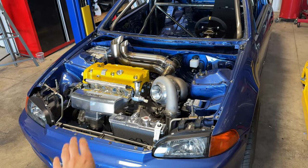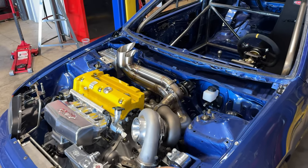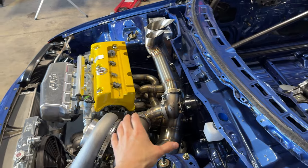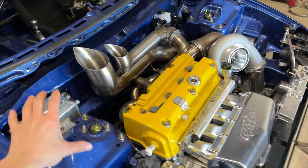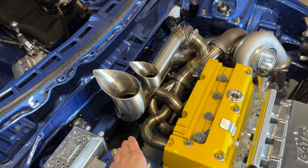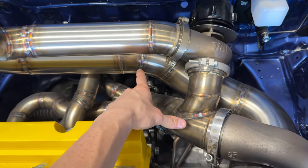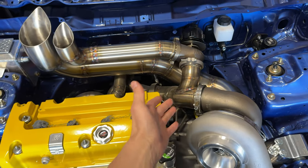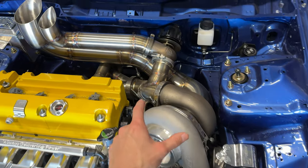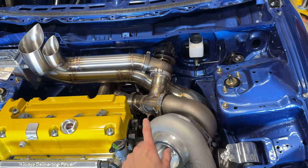The whole plan was to turbo this car. Since I went through such extreme lengths building my perfect car, I didn't want to just order some off-the-shelf turbo kit, and I don't have any fabrication expertise whatsoever. So we had our boys make me the turbo kit I had perfectly envisioned. We have a perfectly equal-length exhaust manifold with a crazy design — I wanted this thing to pop in your face — going up to a billet collector, then kind of an up-pipe section, like a Subaru uses, that goes to our turbo. The reason we had this built is if I ever want to change turbos in the future, all I have to rebuild and modify is that up-pipe section and maybe the downpipe, instead of redesigning the exhaust manifold.